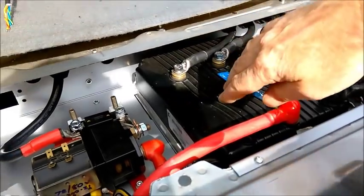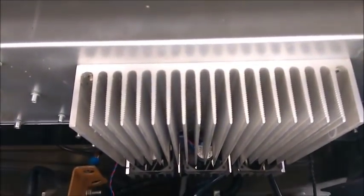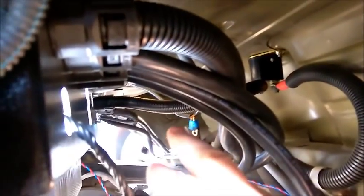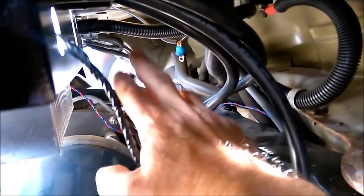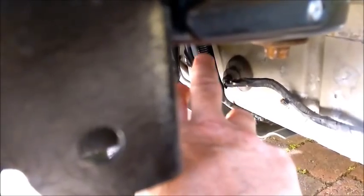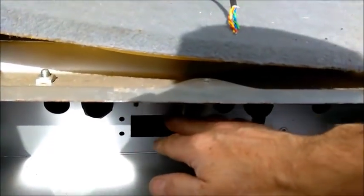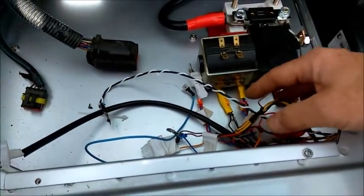I've got the controller mounted directly to a heatsink, and the heatsink is mounted just underneath through a big hole in the control panel. The motor connections are now vertical — the plate is vertical there and these connections are all coming up. I've got everything connected through — this needs a proper grommet in it, which is the hall sensor cable onto the motor. I've got the wires there for the fan, so they need to go up to a socket. I'm going to bring all the low voltage stuff through the panel here, route it through the tunnel, and bring it through to the hole in the panel at the other end.